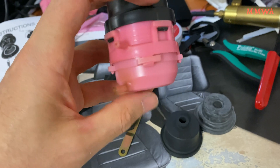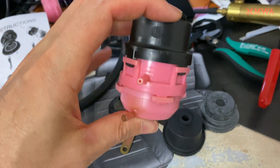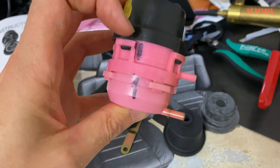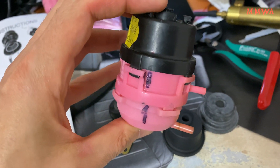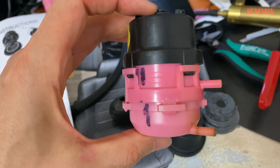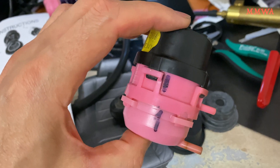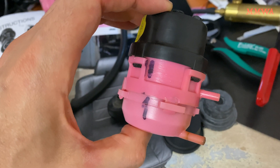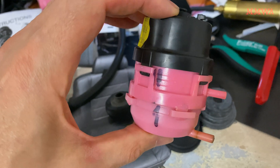With the handheld vacuum pump to get it in the precise position, it's a piece of cake. Don't forget to mark these three housings, because if you don't, you've got no idea how to put it back together, and it is particular to the side of the car and version of car you're installing it on.